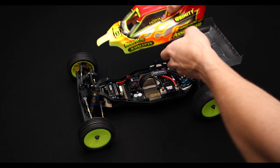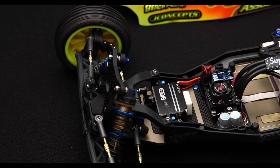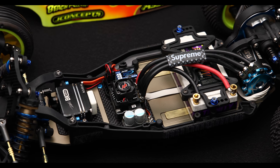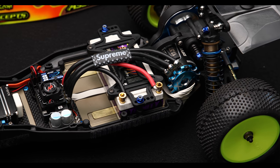It should be noted that this particular setup is specifically for an outdoor dirt track where the conditions are very loose. What we're doing with this setup is kind of two primary things: we're taking a lot of weight in the vehicle and adding some while pushing it further back. We're also softening up the suspension package quite a bit.